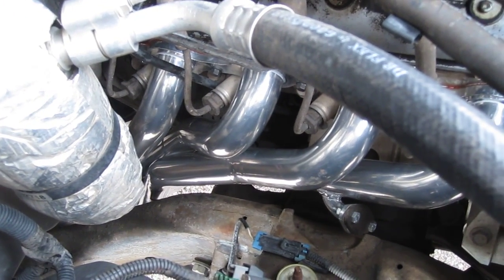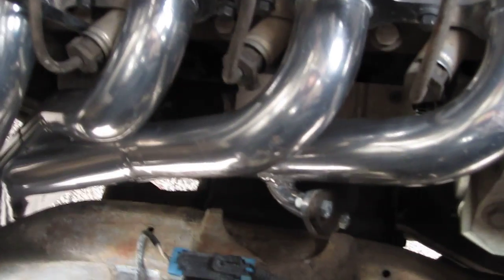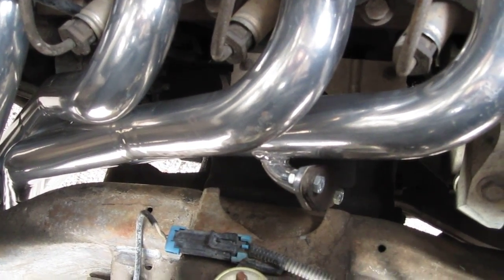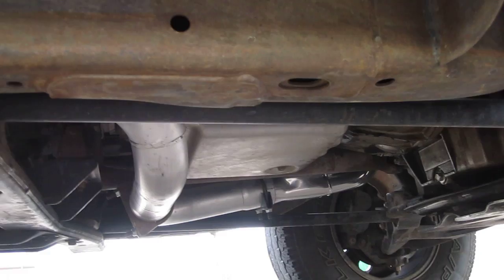I had to bend transmission cooler lines a little bit, about an inch. Other than that, the kit comes with a blank off plate for your EGR valve, and I took my EGR valve off. That went to my intake manifold, then I made a metal plate and some silicone and put it back on. And underneath, when you go underneath, you're gonna have to take off your rear O2 sensors, and there's